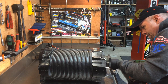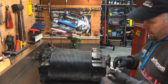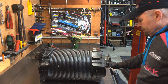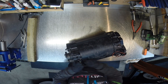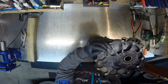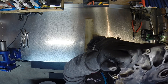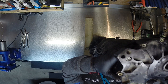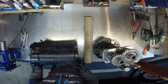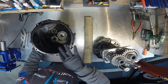As I said earlier, four bolts are removed from the bottom where the gearbox mount goes on. These are a couple of different lengths — self-explanatory, the casing is shallower in some places, so when you're putting them back just be mindful of which way you put them round. That's that done, and now it's a matter of splitting the casing. You don't have to worry about anything popping out — no balls or bearings — nothing's going to come out of here; if there is you're in trouble. Just a quick bang and a bit of shuffling and the casing comes off. There's an O-ring around the edge stopping any leaks — always check it's okay, but you don't normally have to replace it.